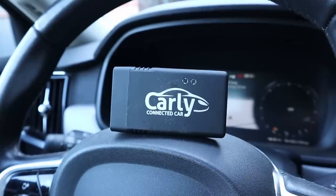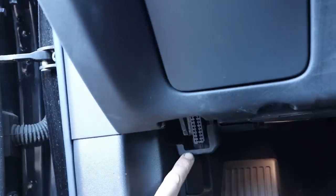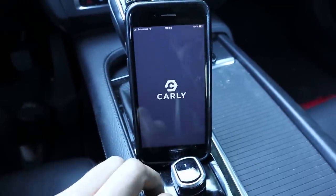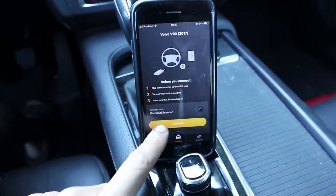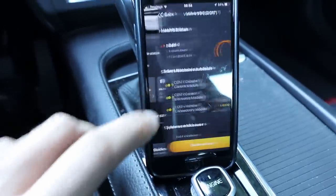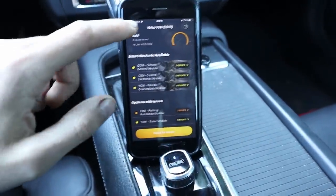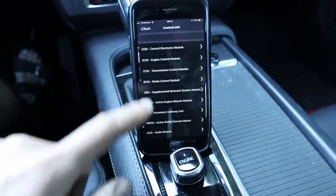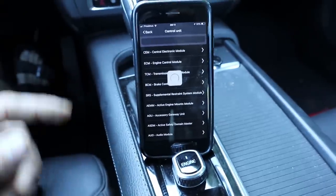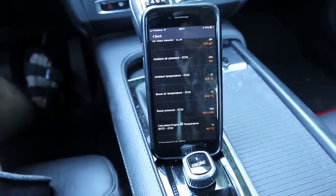My dad asked me to do a pre-purchase inspection on this thing, and a great tool I used for that was Carly. Carly is a very compact OBD scanner that can be used by both professionals and the home mechanic. First we look for the OBD port and plug in the scanner, then open the Carly app, select the car, and hit connect. Carly found eight issues, and they use color coding to indicate severity. My favourite feature is the live data — for example, opening up the ECM lets you check all connected sensors and read their values, which is a great diagnostic tool. A little tool like this is guaranteed to save you a lot of time and money at the shop, so I definitely recommend taking a look at Carly — their information is in the description below.